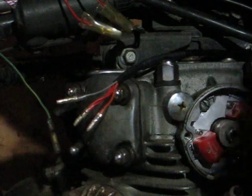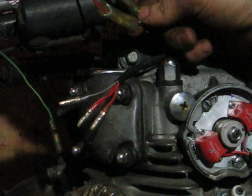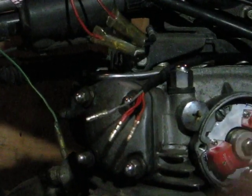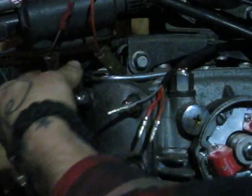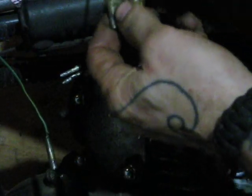Let's talk about wiring it up. So those two plugs that we unplugged the coils from, or the points plate wiring from, you got two other plugs going into those. Those are your condensers. Oh, bike's trying to fall over. Stay. You unplug the condensers out of those 2-into-1 bullet connectors. Tuck your condenser wire away. Remove them if you want. Leave them if you want. And then these 2-into-1 both go over to your coils. You ditch those.